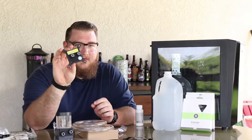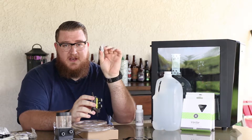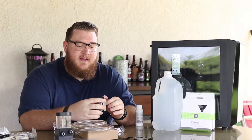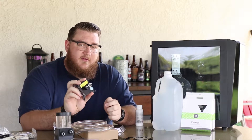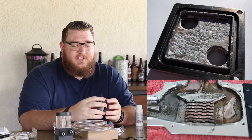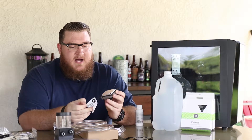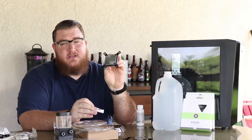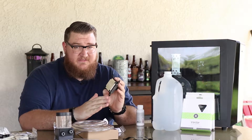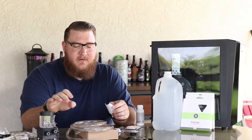This is the important part — this is your water block. Now this system, since it's all aluminum — and I mean all aluminum — these fittings are aluminum inside. They're not brass like you're going to find in a lot of systems, and they're not copper. They are full aluminum. The reason for that, as I said earlier, is galvanic corrosion, and I'll throw some examples up to show you what galvanic corrosion is. It's not pretty — you definitely want to avoid that. The base of the block is pretty much just machined; it's not super polished, which is fine. It just has to be flat — that's the biggest thing. And this is nice and flat, nice and true. You also have aluminum fittings on that.